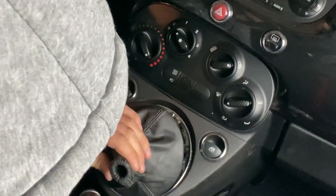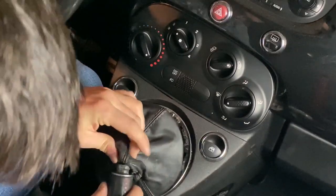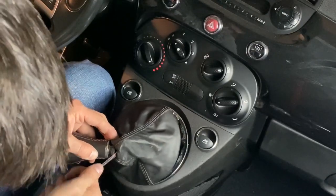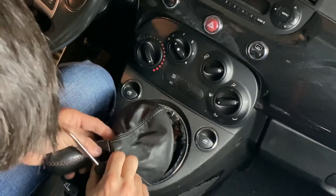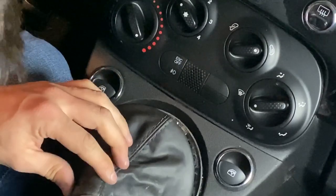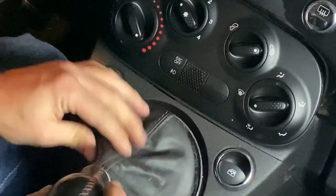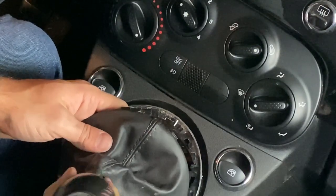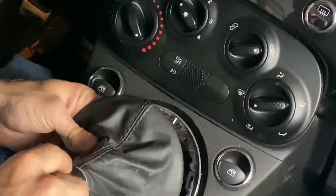It was definitely worth switching out. To get the new shifter in, it's going to take a little bit of force. I use the same flathead screwdriver and kind of wrap it around that little ledge on the shifter and twist it on — same concept as putting a bicycle chain on. I also removed the shifter boot from its base so I could lift it up a little bit, making it easier to get it high enough to put it on the shifter without struggling as much.